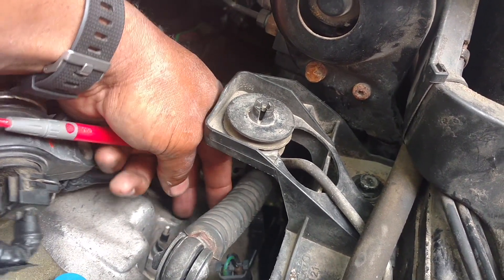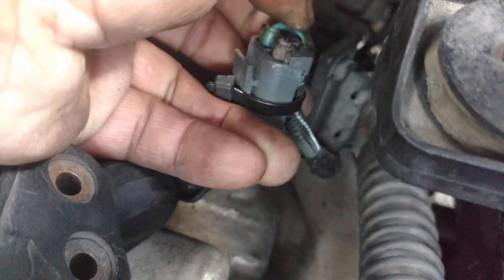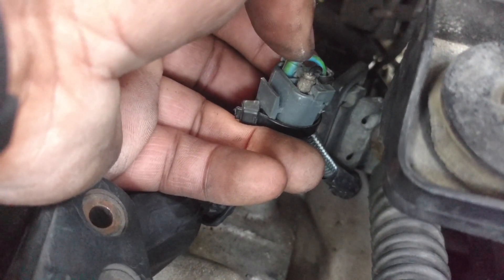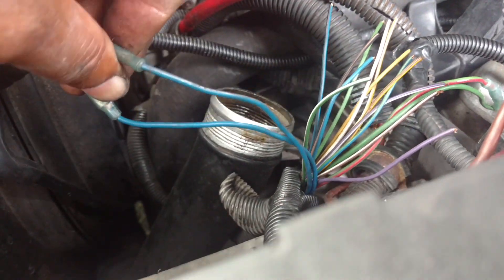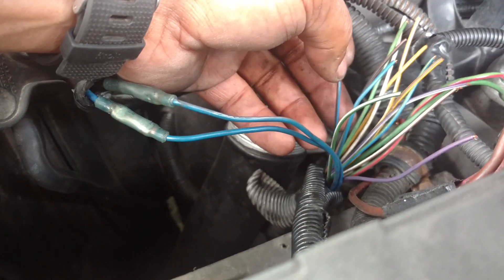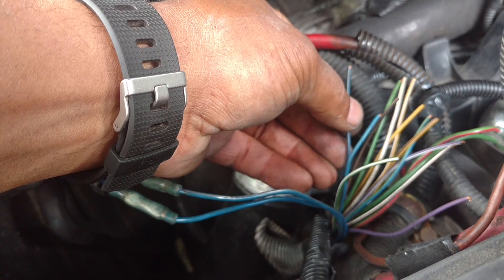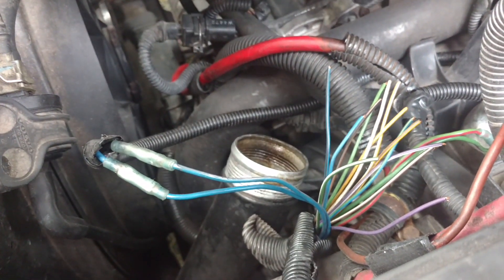I need to find the wire that's sending the juice back to the reverse light without blowing my fuse. What I thought was a reverse light wire is a blue wire with a green stripe on it. I'm going to look at my buddy's example for his '95 and see what wire he had connected. My buddy had a red and black and a blue and black. I don't see a red and black in here — I see a red and green. I do see a blue and what looks like purple, and here's a blue and black. So I'm going to make sure all these wires are separated, then hook my positive up to this blue and black and go to the back of the car and see if I have reverse lights. If I do, that's the wire I need to use. With the ignition off, I'm going to go through each wire one by one until I get reverse lights.